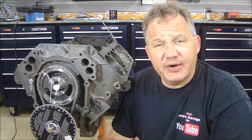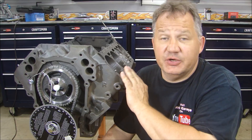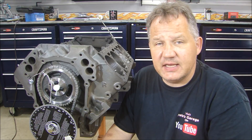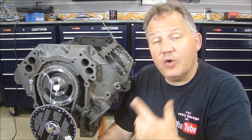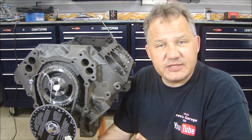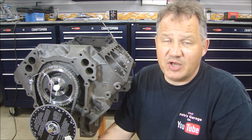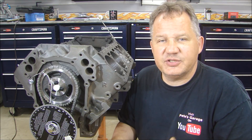The burning question usually is: do you have to degree your cam? And the answer is no, you really don't have to. If you get piston number one at top dead center, the keyway is in the proper orientation, you get the cam sprocket and crank sprocket lined up zero to zero, and it goes together well, there's no reason to believe it won't perform as expected. It is nice, however, to go through those steps to make sure you have the right cam — the valve was opening exactly where it was supposed to, it stayed open through the advertised duration, and we got the lift out of it. All three matched the cam card exactly, so it's a good check to make sure someone didn't accidentally throw the cam in the wrong box or get something mixed up at the factory.